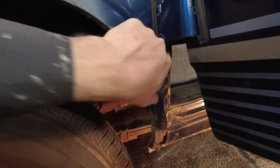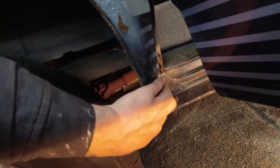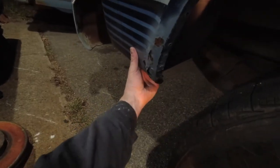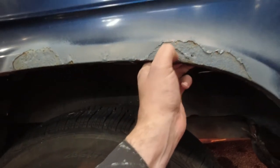this piece, this edge here of the door frame, I'm gonna save. I'm not gonna try and replace that if I don't have to. I'm gonna have to a little bit down here, but for as much of it as possible. So I'm gonna come in fairly tight around here if I can to replace it, and then back here I'm gonna bump out and probably use the entire piece for this rear section that's rotted, and I'm gonna have to do possibly a little rebuilding on the inside there, but it actually feels like there's not much that we need rebuilding there. That's not rotted through. This is rotted through to the back piece, but the back piece is still essentially solid.